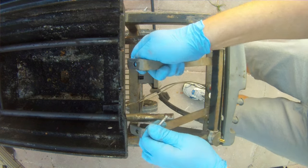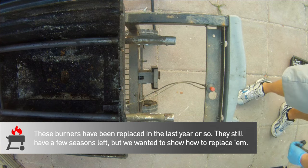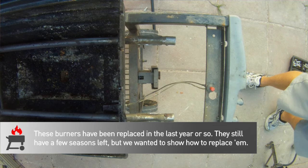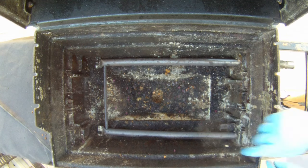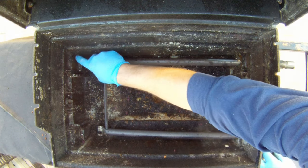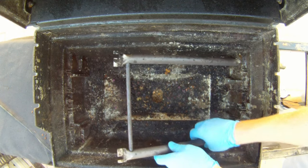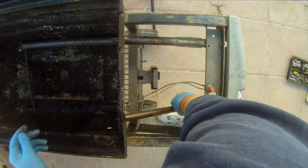It's important to remember that when shopping for replacement parts, a significant portion of the burner is outside of the firebox. This burner is actually 27 inches long, but only 23 inches or so are actually inside the grill. There are two screws that hold the burners in place at the tabbed end, but they're just guides — you shouldn't have to loosen those to get the burner out. Just slide the tubes off the screws and gently separate the assembly and it'll slide right out.